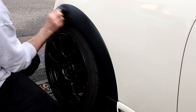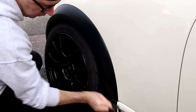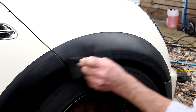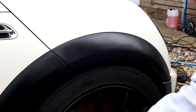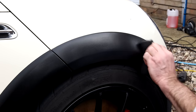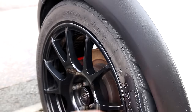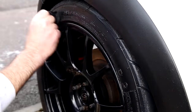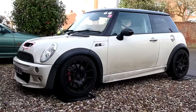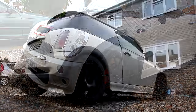Re-coated the headlights in wax and we were done. Next up — trim care. This is a water-based trim sealant or rejuvenator. Minis are prone to these going faded and nasty; the rears aren't too bad but around the fronts they're not good. It's a gel-like formula — apparently you can't use this on tyres; it's very, very gloopy and sticky. Allow it to dwell, leave it on for a while, let it dry out and then buff it off. What I noticed the next day — it was still on there; it didn't fade, which is unusual. Next up, last but not least, is Garage Therapy's tyre serum to help seal up the tyres ready for the next excursion. Here's some before and after shots.